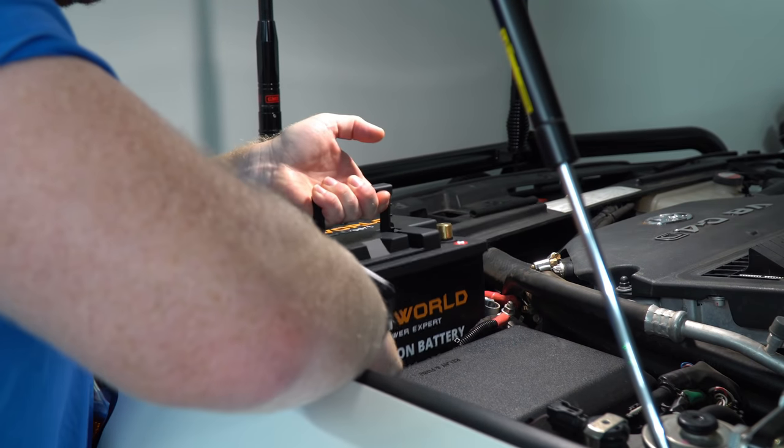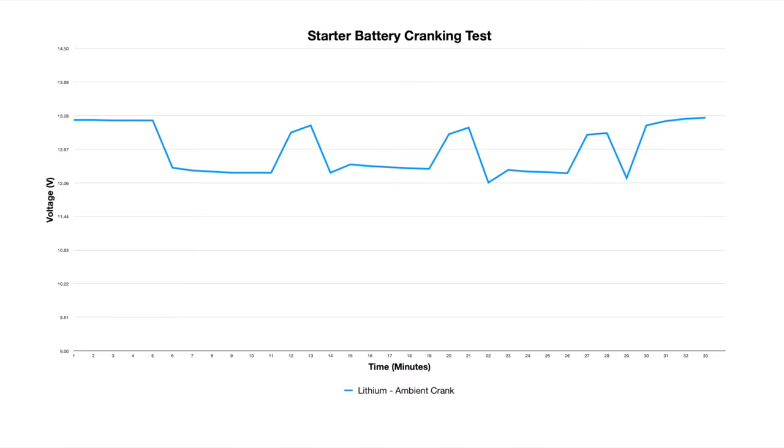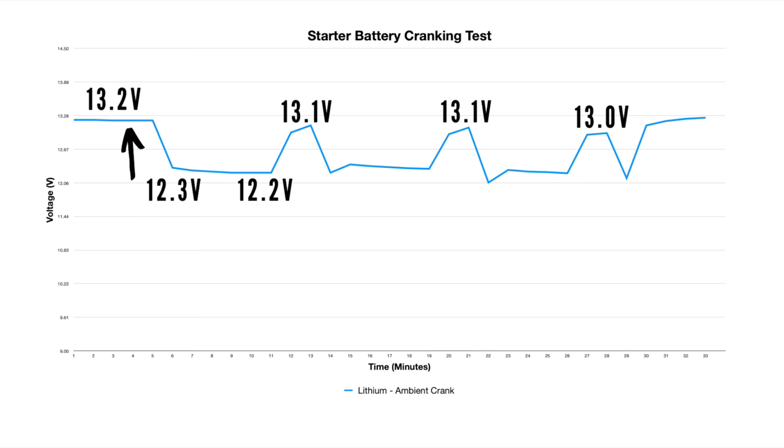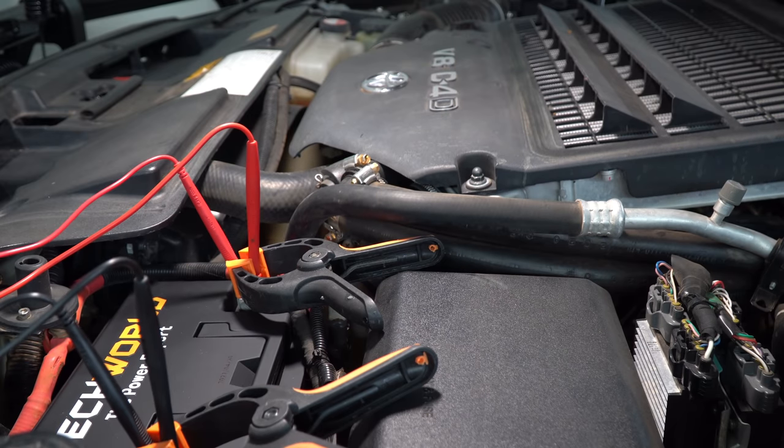Now it's time to test the lithium, running the same cycle periods. We can see a similar but slightly different result. Switching on the ignition appears to have little to no change to the lithium's battery voltage, remaining at 13.2 volt in the first instance and above 13 volt in all of the cycles. We can still see that voltage drop as the vehicle demands a huge burst of power, however that voltage remains noticeably higher. Even at the troughs and peak demand, the lithium still managed to stay above 12 volt. This test corroborates the voltage discharge profiles from the capacity test, and we can even hear the difference in the sound of the crank on the big V8 — because the lithium has a higher power output and is able to spin that starter motor at a faster rate.